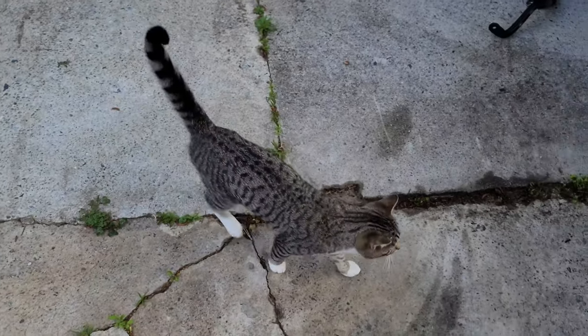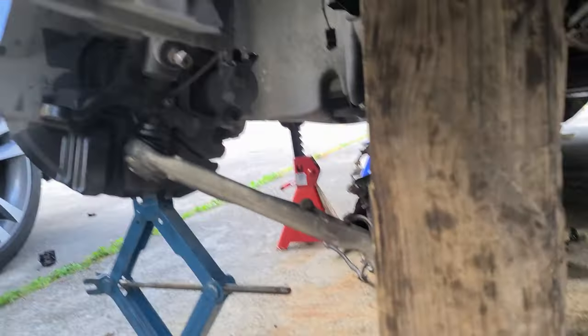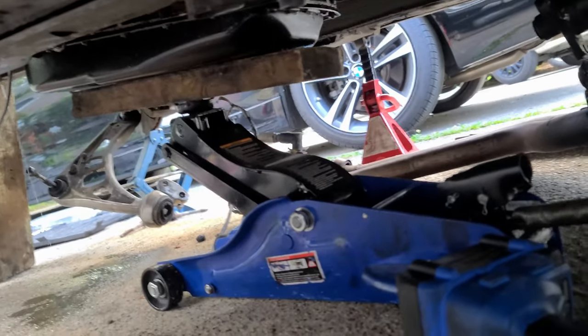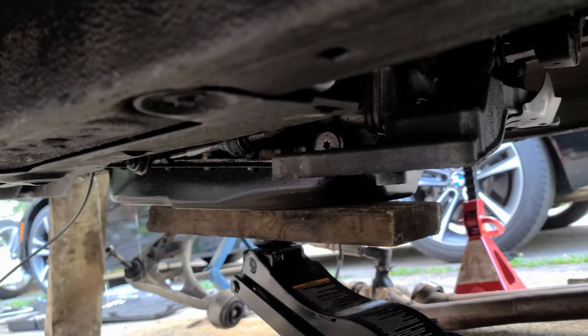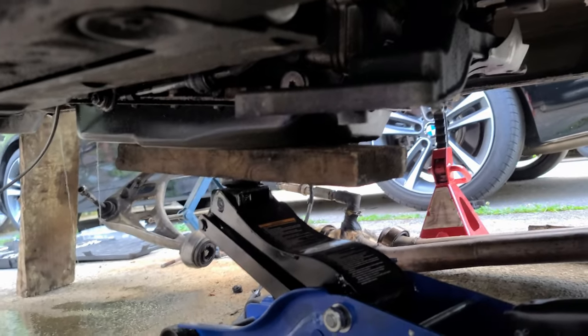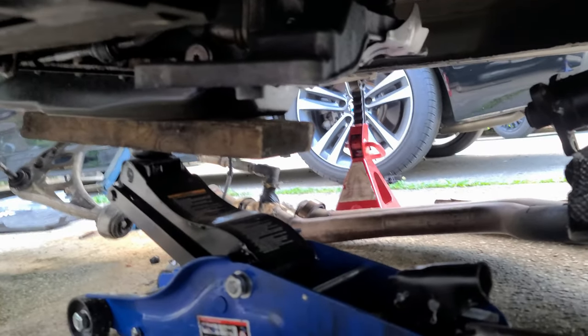Now is this. So the bottom is gone, everything is gone, so I disconnected everything. There is pretty much no subframe, so the engine is held by this, and I'll be rolling in the dolly. A lot of bullshit. So what I'm gonna do, I'm gonna first lower it, unhook it, then raise it, then screw it back, then put the dolly under, then raise from under the dolly, and then unhook it.